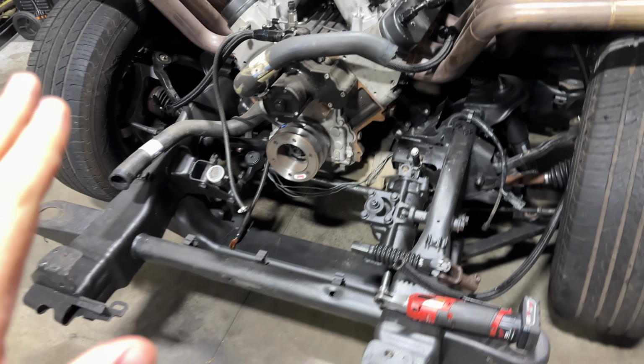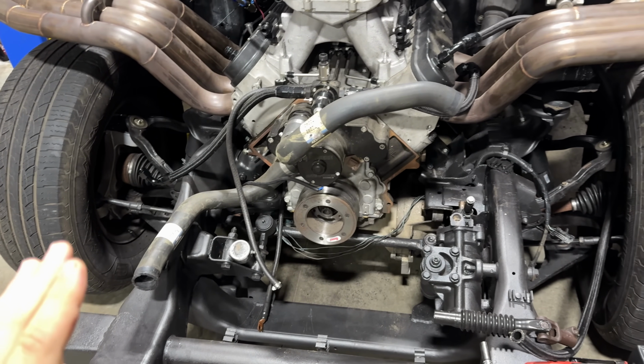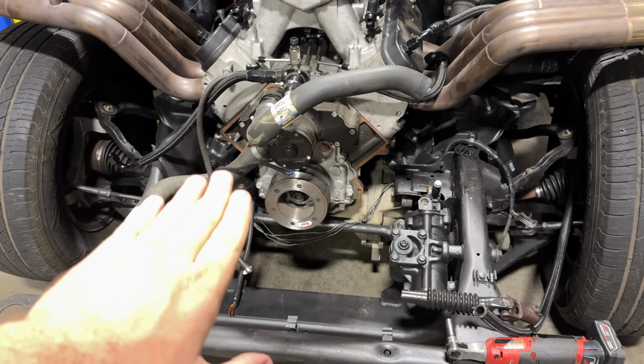All right, the other thing that I have figured out, I've talked to a lot of four-wheel drive guys. They're telling me on this four-wheel drive axle to go ahead and just kind of jam the actuator. So they turn down a sleeve, basically, put it in there, and it locks it in four-wheel drive all the time, and I'll just control it with the transfer case, so I don't have to worry about finding an all-wheel drive diff. However, this rear end that was in this truck had a 410. That is either a 342 or 373. So I ran down to our local salvage yard, and my buddy's dad hooked me up with a 410 front diff for this thing. So I'm gonna get those swapped.